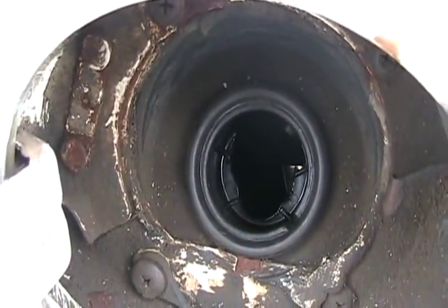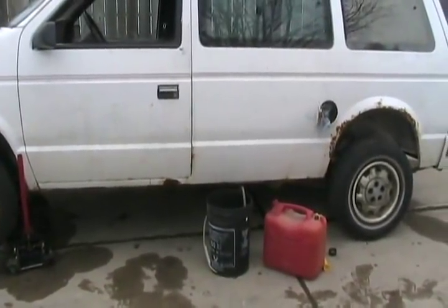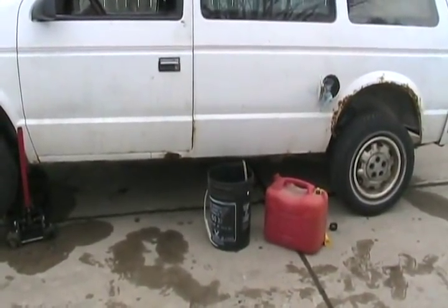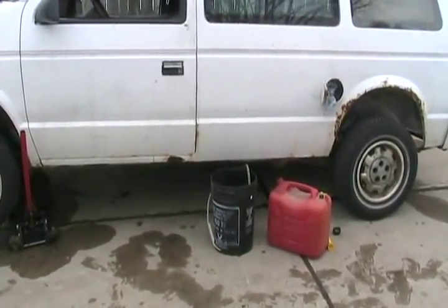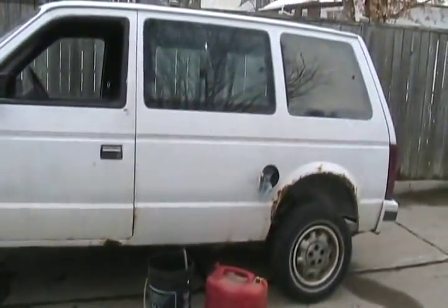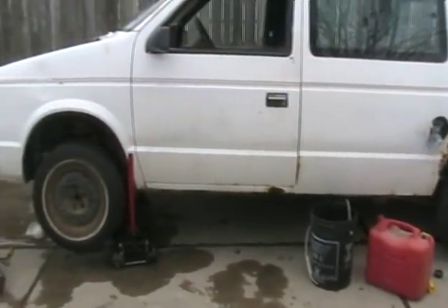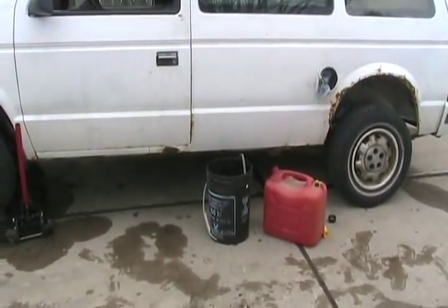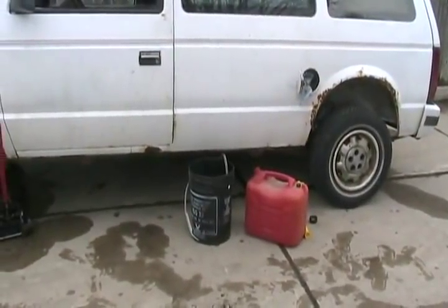The gas tanks on Chrysler vehicles have one extra tube coming out of the top of them - it's just got a rubber cap on the end and goes nowhere, it's corked. Well, that's your fuel drain tube. In case you have to remove your gas tank, you just start sucking on it, add a hose, and it starts siphoning itself out. When you're running your vehicle on a diesel conversion, you don't need the fuel pump in the tank - they suck their own fuel through the injector pump. So that extra tube used for draining the tank is hooked up to my input fuel line to the engine.